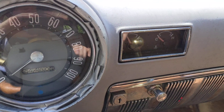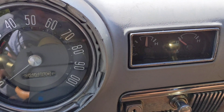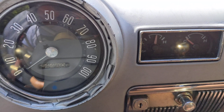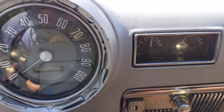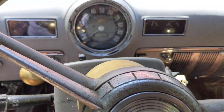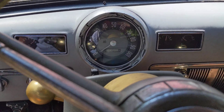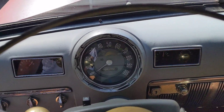While the pressure is up, I flip the switch back off, turn the key, and start the engine. You can see the oil pressure builds even higher. The engine started very quickly — I haven't started this car in about three weeks and you can hear how quickly it turned over. You can tell a big difference when you pre-oil the engine versus when you just start it cold; it takes a lot longer to start and I believe that contributes to wear.